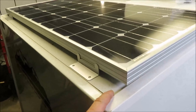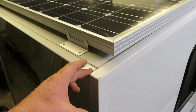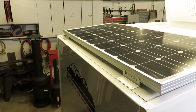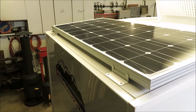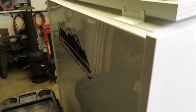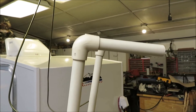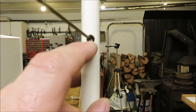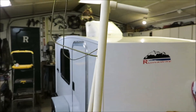Right now I'm working on some PVC pipe. I got some half-inch pipe — I'm going to put a half-inch pipe down this corner and a half-inch over there on that corner. There's two wires, and I thought if I put them both in the same pipe, they would both fit in a three-quarter-inch pipe, but I think it would look awkward. So I'm going to put one down each side and run one wire down each side of the camper so both of them look the same. Here is the pipe I'm going to use — this is just a white PVC pipe, hot and cold. I drilled some holes in it, and that's where I'm going to screw them to the camper. I put one screw on top and one on the bottom. These things are light as a feather.